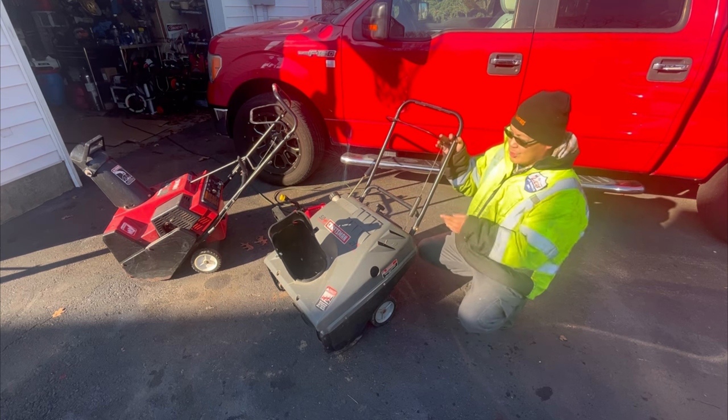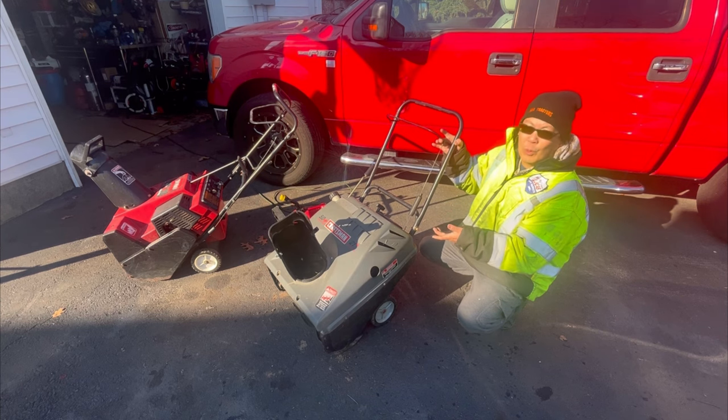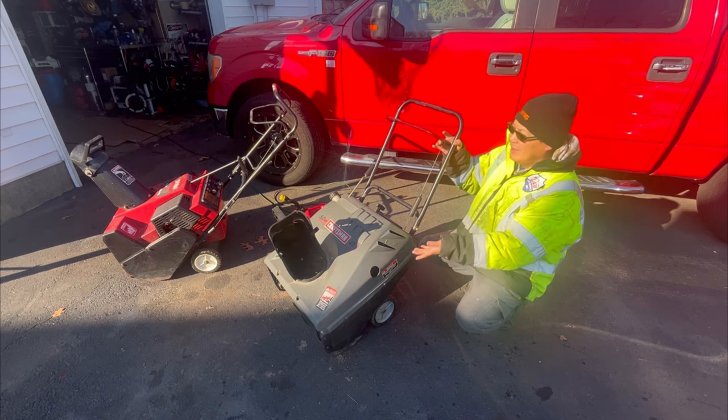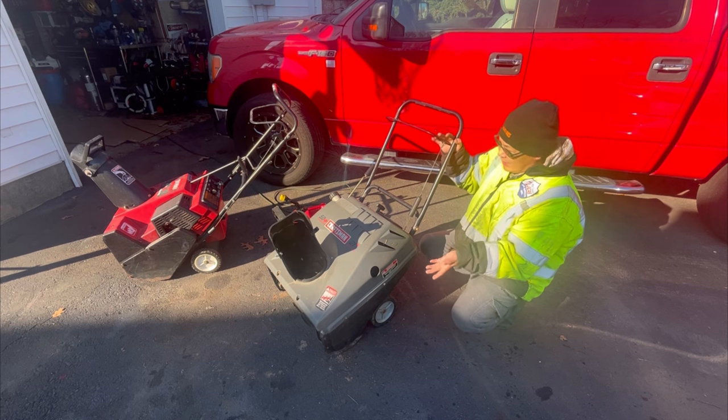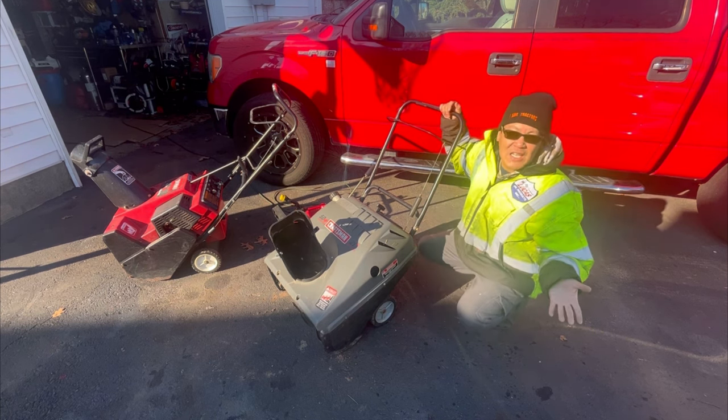And now it disengages. So this wire was too tight, and the minute you touched it like a quarter inch or something like that, it would engage it, and it wouldn't disengage. So I just loosened it a couple of clicks. Fixed!